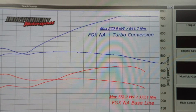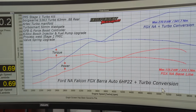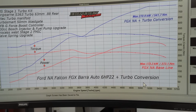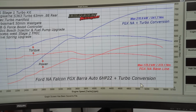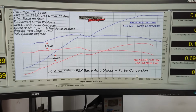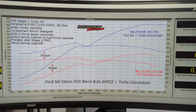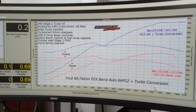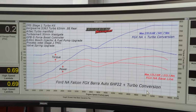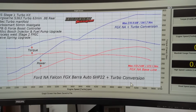you need to be a little bit cautious of how much more torque you're going to throw on top of that trans. And if we can't get in there and adjust the trans pressures, there are other things we can do in the calibration which tell the TCM that it needs to apply more, but at the end of the day, it's not going to be enough to keep the transmission alive. And if we get greedy and start pushing the power, then we are almost guaranteed to break the trans. So until the customer says, I want you to keep pushing and find the limits of the trans, I don't know what the limits are yet. But I'm happy to leave it at that and keep the torque down as much as we can.